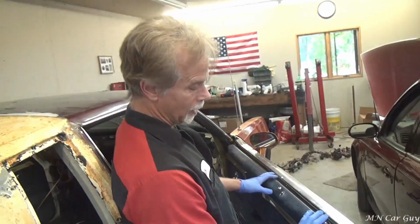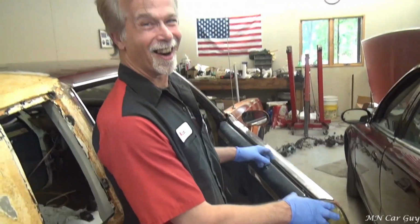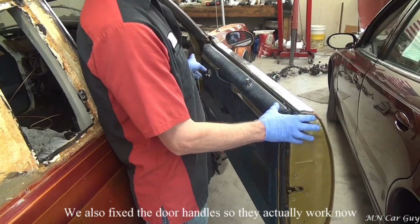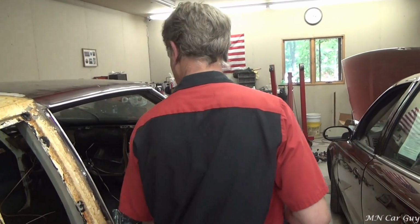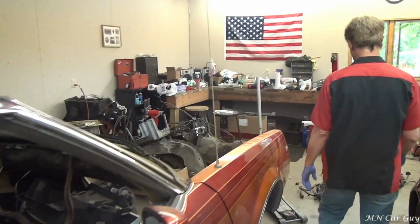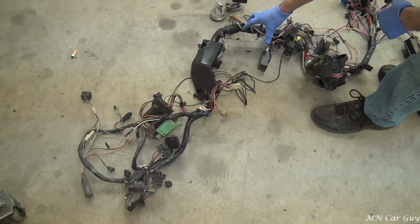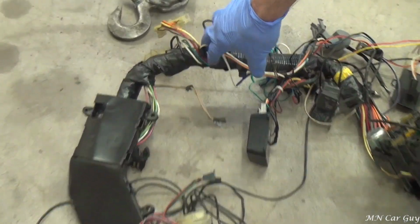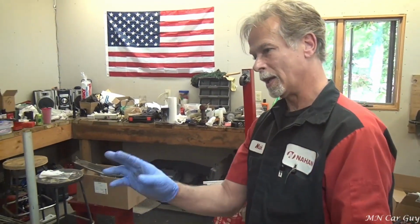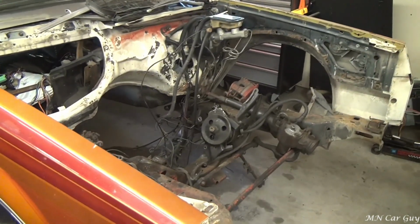Prior to installing the new pieces in the door for the window and stuff, we noticed that electrically it would lock the car on and off. It would do it in repetition. And then also the power window switches weren't working. So while we were tracing those wires to see what was going on with that, we found out in the harness here, it has an aftermarket alarm system and a rat's nest of wiring problems from there. So we decided then to change over the harness from the unmolested car, and all that will be restored again, as far as operating all the little gadgets.